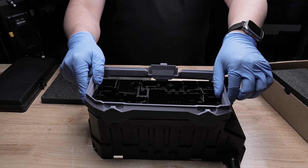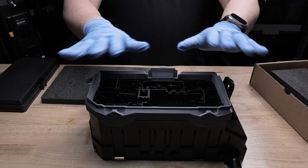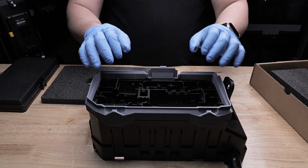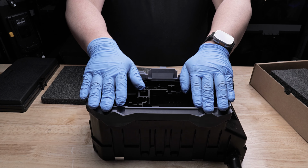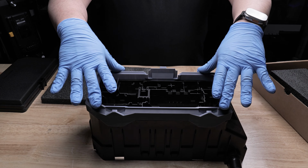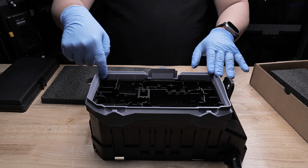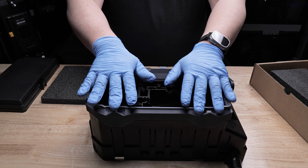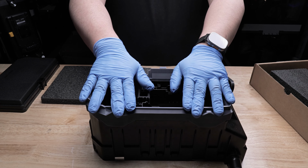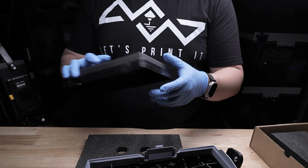Once we do that, go ahead and just gently align it. It should just start to line up. It won't fall directly in place because it's going to be a very tight fit. You'll place your hands on both sides like this. Gently press down, but don't press down all the way just yet because it's now resting on top of the 3 tabs. Go ahead and check one more time to make sure everything is in place. And then in one big push, we will place your hands evenly here in the center and just press down and you'll hear a big pop. Riser is in place. Now let's go ahead and reinstall the lid.